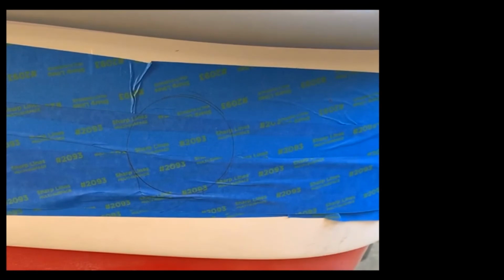So one of the first things we had to do was take the MC transom remote, and we decided we need to get a good trace, because once you drill into fiberglass, there's no turning back. So we got the unit traced to fit, and then there's the hole, which was pretty cool. Was pretty scary putting that big of a hole into my boat, but we sealed it up, chamfered the edges, and then attached the transom remote, which looked awesome in my opinion.